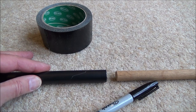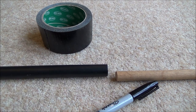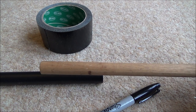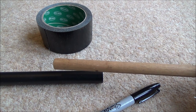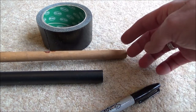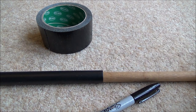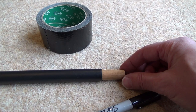What I've done is I've cut this piece of copper pipe which has been powder coated black, which is just nice for inside the Berlingo. It's slightly too big, so this piece of dowel is exactly 15 millimeters, which is perfect to fit inside the little plastic bracket inside the boot space. I'm going to slide that inside and wrap gaffer tape around that end just so it fits in snug.